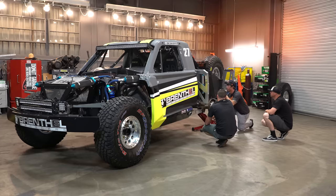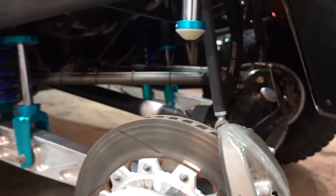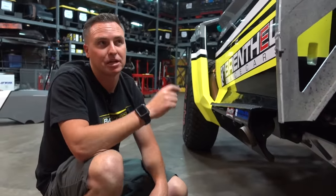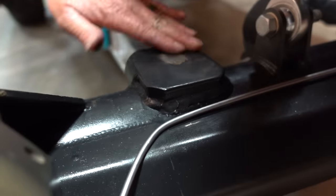Bump stops just like the front, but these ones have a four-inch stroke since there's more travel back here, so we have more damping as you come up. You can set the pressure to adjust if you want it stiffer or lighter. That goes onto a specially built bump pad because it sees a lot of force — you can see the wear mark there. And looking back through here, there's so much cage work and cool stuff.